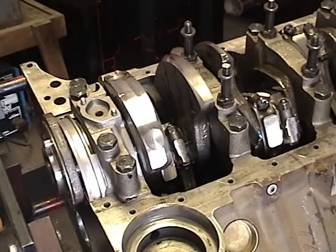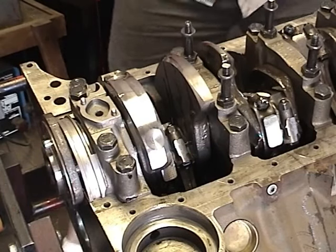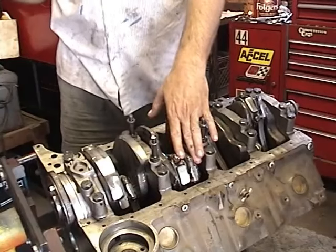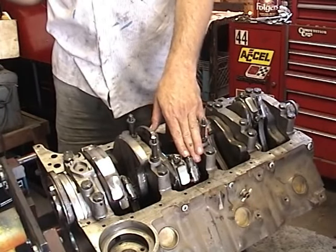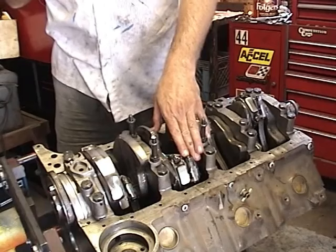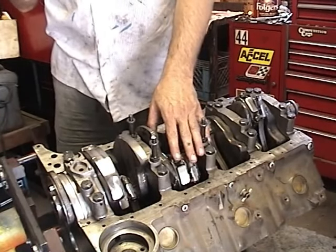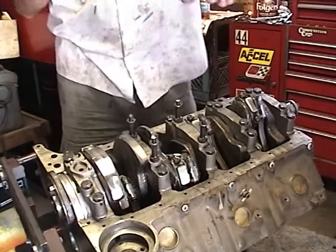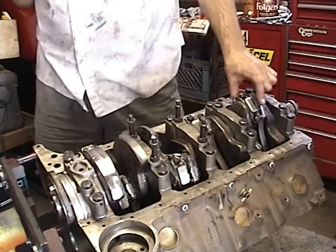These particular bolts and rods are going to be torqued at 50 pounds because they're heavy duty bolts. Set the torque wrench at 50 pounds. Connecting rod bolts are hardened lock nuts and hardened bolts, and they're going to be a higher torque specification than normal, which would be 50 to 60 pounds. But again, always check your service manual according to your engine — that's going to be different from engine to engine. But this particular one, we're going to torque these down to 50 pounds of torque.